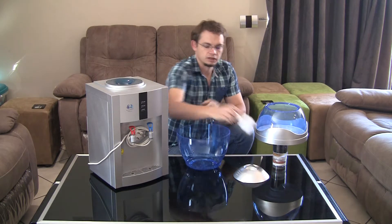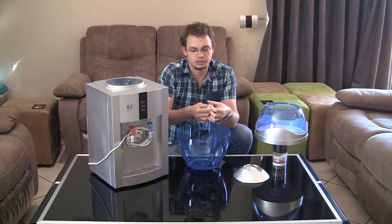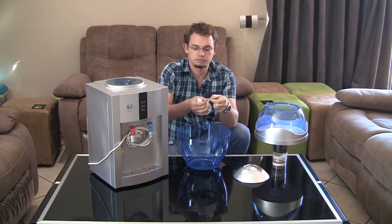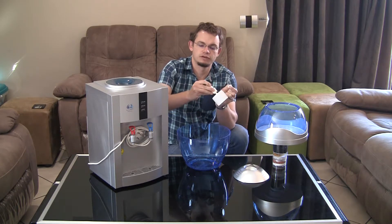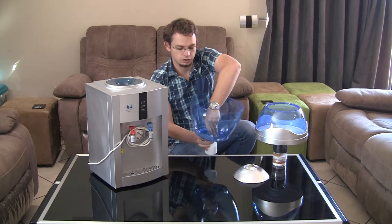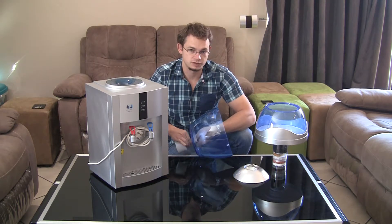The next part is the float, which controls the water on the filtered water side from going in and out of the cooler. It has a little nut that you just loosen by hand. Importantly, it has two seals that sometimes stick together — you need to pry them apart, as you need one of them over the float, just over the thread. Put the float with one seal in through the bottom, then place the other seal and tighten with the nut. It doesn't need to be extremely tight — hand tight is normally more than sufficient for a good seal.